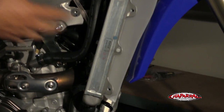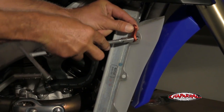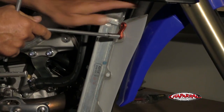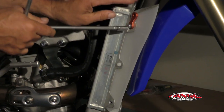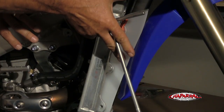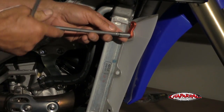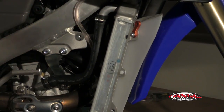So now that our radiator is down, we need to put these brackets in place so that you'll have your original bolt location for when you replace your side shroud. So we just put these in place — just about straight up vertical is the best. Once you put your radiator shroud back on, if you need to do any adjustment, just pull it back out, loosen this, move it over just a touch, re-tighten. Pretty much straight vertical is where it's going to need to be.